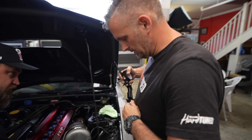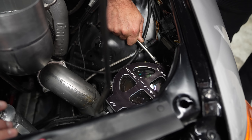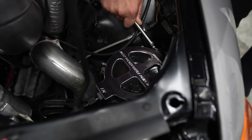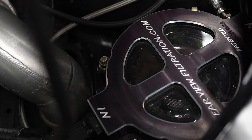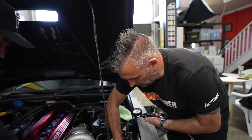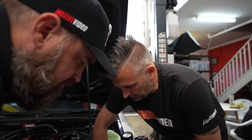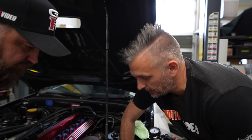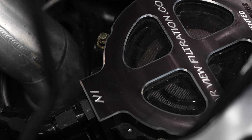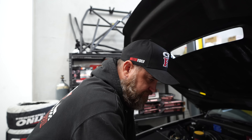So basically to use the Clearview between runs — you can hear all the oil going everywhere. You see the screen now? You can see the screen. There's always going to be a little bit of stuff, but it's all silver — little silver flecks, which is more like the kind of material you expect from alloy. But what we're looking for is actual bearing material. Look at that! I might have to invest in one of these. This is cool.